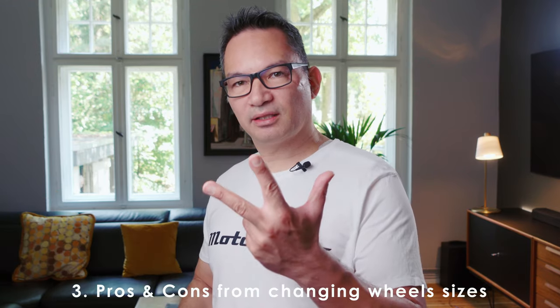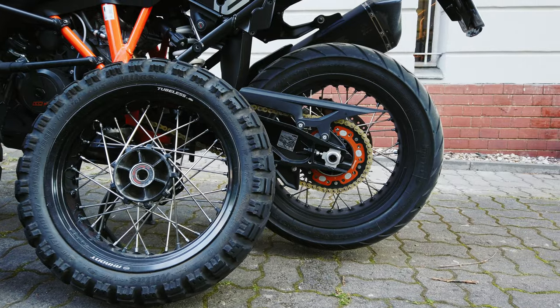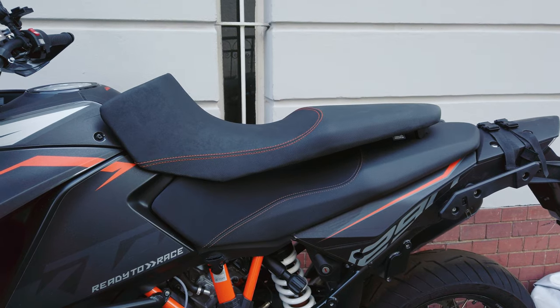After changing from larger to smaller wheels on my KTM, there are three things I noticed that most people don't talk about. First, it actually reduces the overall height of the bike. For a shorter rider who wants to ride an R model, going with a smaller wheel size brings the overall height down without touching the suspension. A lot of people look at lowering the suspension first — that should be the very last thing to touch. If you bought the R model for its great suspension, do everything else to lower the bike first, like going with a smaller wheel size or a lower seat.